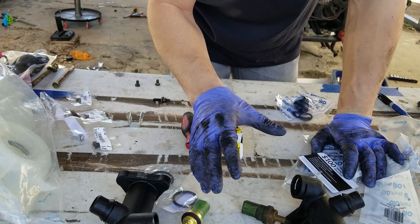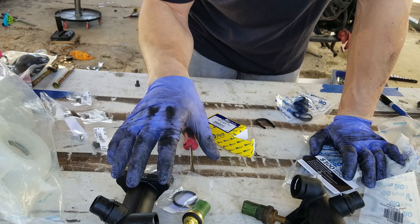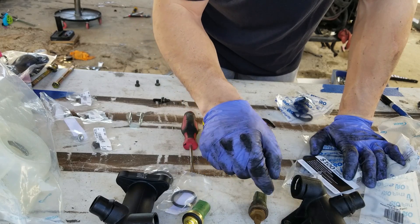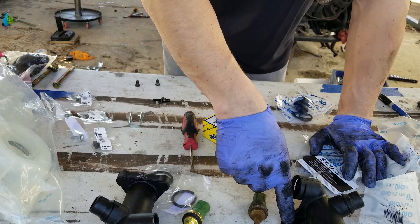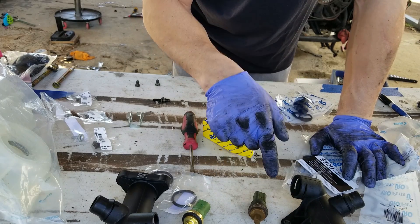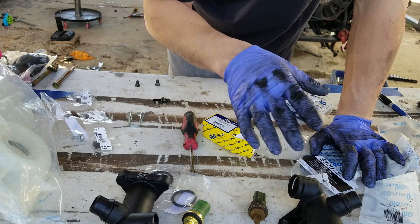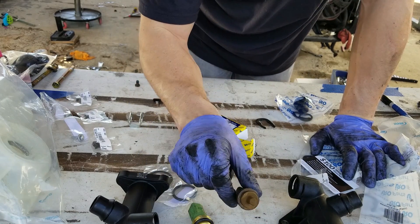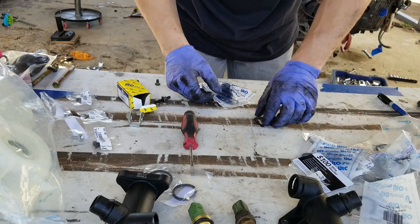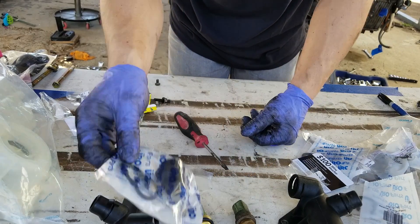That was actually a really easy job. Without my SAI installed I had a lot more room to work back there. All I really had to do was disconnect the turbo oil feed line, and that gave me access to the bolts. Something I noticed was that the top bolt wasn't even connected to the head — that's definitely where I was having my coolant leak; I just didn't have it clamped down. Luckily, ECS gives you all the parts you need. This is the new temperature sensor — you can see the old one has lived a hard life. ECS sends a new clip and an O-ring as well.